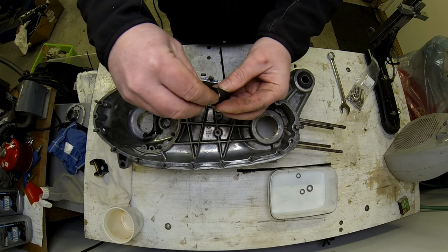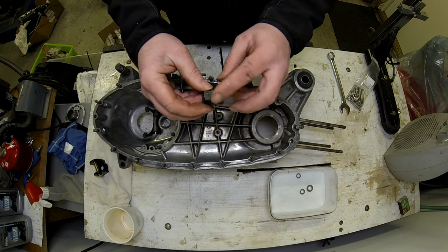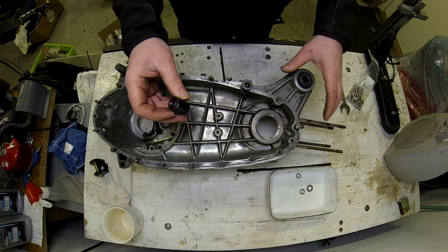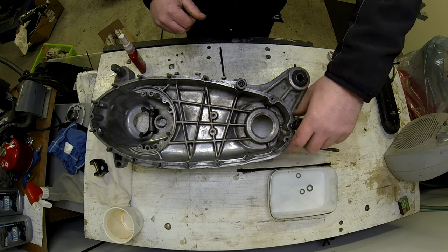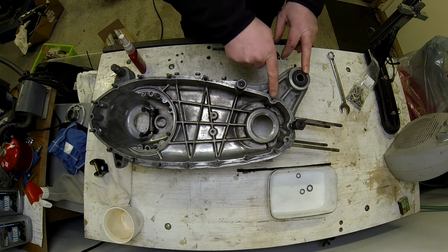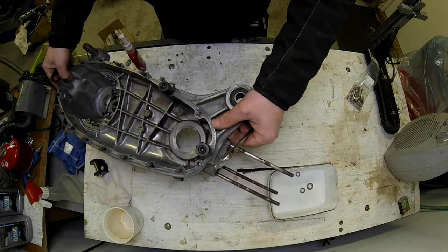So you've got this stud that you screw in the top of the stud extractor. This set here comprises M8, M6, and M10. I'm pretty sure I bought this off MB Scooters, but you can find them in proper tool shops. So what you basically do is you just wind them down. Now, if you find that these are a pig to get out, or you get some slippage, you can apply some heat. But as you can see, I've removed one here already, and I'm pretty sure these should come out pretty easy. So I'll move this into the center of the shop.